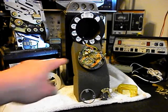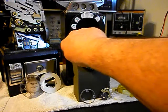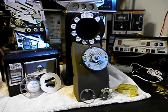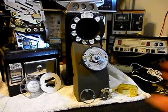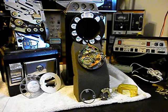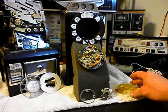We're also working on the rotary. We want to make sure it's cleaned, oiled, and adjusted. We want to take a look at the points, make sure the rotary is racking off properly and that the numbers are being dialed properly. Earlier in the video we showed that the finger stop was really loose — that issue has been taken care of. If you've never seen the inside of one of the rotaries out of a three-slot payphone, this is a 233G. We have various parts here that belong to the rotary, and we have a dust cover.